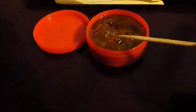Okay. I got all four of them that I had left lined up there. Let me try and get this in focus. You see them there. Now, where's the toothpick? What's easiest is if you dab it on your tongue and you pick them up lengthwise, like so, and try and line them up while using your other fingers to keep it in the grooves. Once you have it in, pretty much the needle nose pliers hold them in place, then you can come through here and use your flux, which is what your solder is going to adhere to, and kind of dab a little bit on each one of the metal terminals on one side at a time. Do it little by little, one LED at a time.